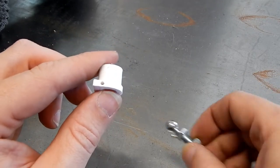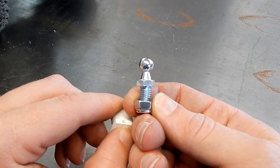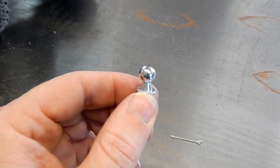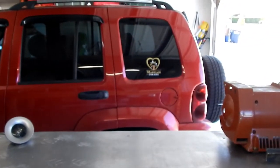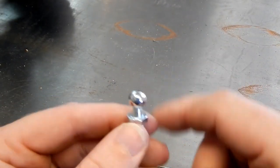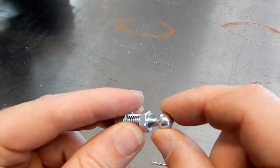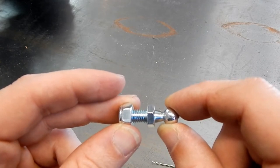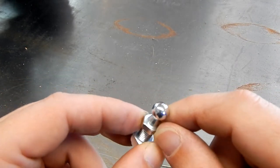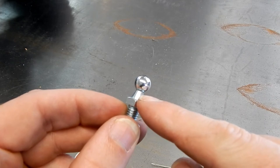If you haven't seen any posts on my CXT build — this is actually the ball stud for gas struts that are common on a lot of vehicles. In fact, the back glass on the wife's Jeep Liberty uses gas struts to hold it open, and they just snap on here. Now this is a 10mm sphere, so it might be a little big for 1/10th scale or smaller, but the CXT is so big — it's 1/6th scale — it still looks a little big, but I'm willing to sacrifice a little bit of scale because I know how much weight these can hold.